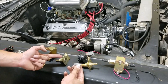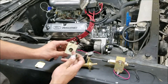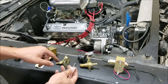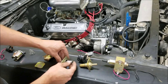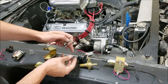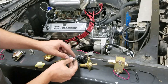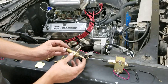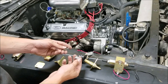This side is fuel coming in and this is fuel going out. Built into this guy right here is a little check valve, so you can't force fuel to go this direction — it will only go in. It's a one-way check valve. When it triggers, it pulls this piston back, and this little flapper goes forward and allows fuel to flow in front of the piston. Then when it demagnetizes, the spring pushes this plunger down through the bore and pushes the fuel forward.